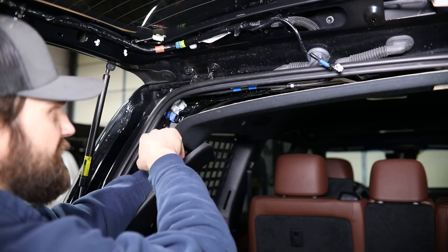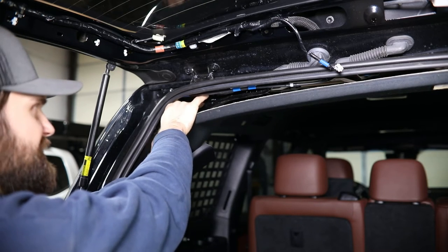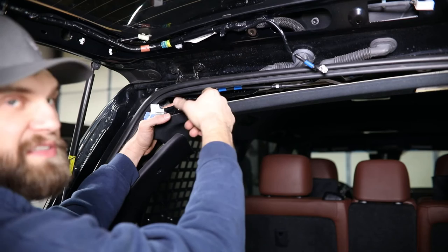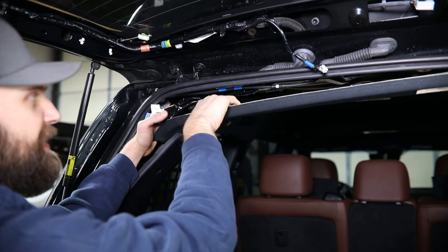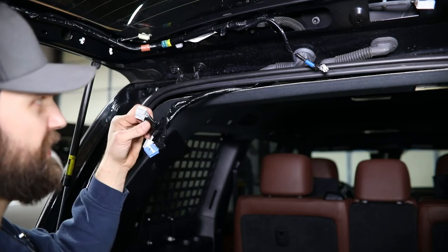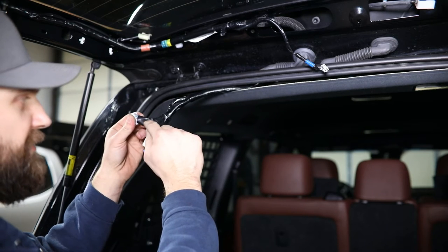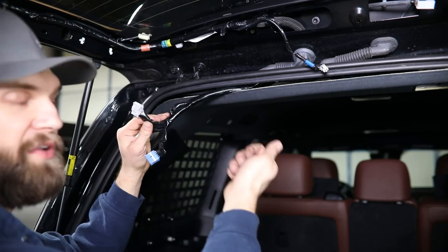Next, up here at the body in the top driver's side corner, we're going to have these three wire harness connectors that need to be unplugged. These are all just a single thumb-tab style that needs to be depressed before sliding them out. Then with these three unplugged, we're also going to need to either remove the clip that holds the harness in place or remove the harness from the clip. If you're having trouble getting the clip removed, the harness is just held to the clip using black electrical tape that can be carefully cut, allowing you to free the harness up. With these unplugged and the harness pulled partially out of the vehicle, you're going to be looking for the gray connector — that's the one that houses all your camera wiring. Once you locate that, very carefully cut back this wire loom as far as possible so that we can tap into these using our new provided wires.